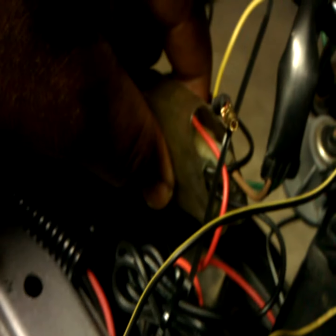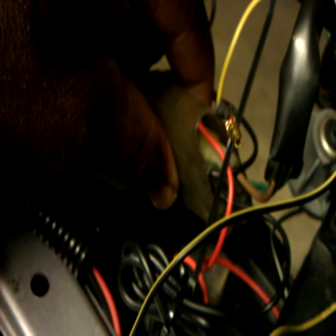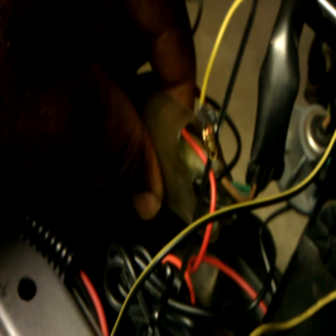When you pull that out, you got to remember which one you got to plug it back into, or else you're going to go back through a whole cycle of trial and error to figure it out. That part I can't show you and do, so what I'm going to do once I get both sides hooked up is just plug them back into the harness right here that goes right in there for the light controllers, the blinkers and whatnot. If you have your blinkers hooked up, that's the thing you're going to have to deal with when you're trying to hook the integrated tail light up. The rest of the install is pretty much self-explanatory. These slide in where your other light comes out.